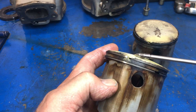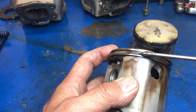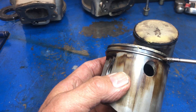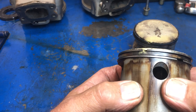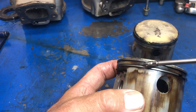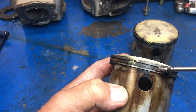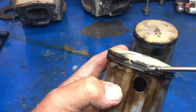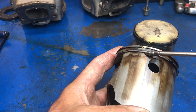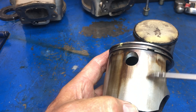The combusted mixture of those three items — gas, oil, and resin — goes past the top ring and makes a deposit right here, then makes a deposit in here on the second ring. The second ring is pretty much stuck, resined in — you can see the shine in there. It's in there pretty good. It can't seal anymore properly, and then the combusted gas just continues down the side, which is what all of this is.